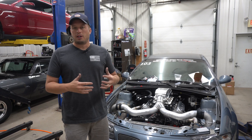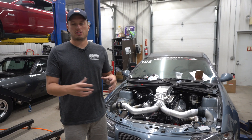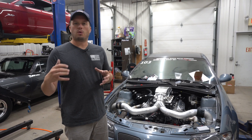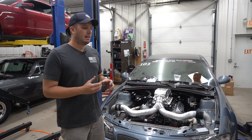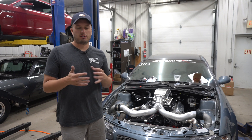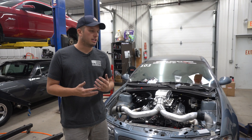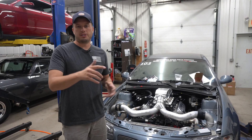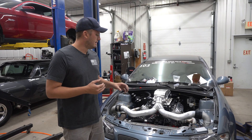When you're laying out the cold side or laying out a turbo setup in general, a lot of times the hot side is the most complicated because you're trying to get the headers out, the downpipes are really big, and the headers are complicated. So the cold side is usually quite an afterthought. But every 90 degree bend, give or take a little bit, is about a pound of boost, and a pound of boost can be a decent amount of horsepower. If you have a bunch of extra bends that are unnecessary in the system, you're robbing boost and robbing horsepower.